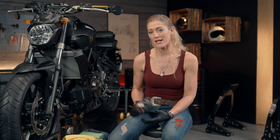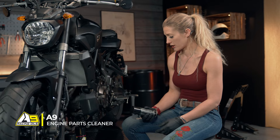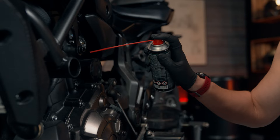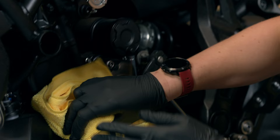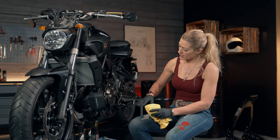That is the A9 brake cleaner. Let's move on to the engine parts cleaner. Again, this is quite a toxic cleaner in terms of your skin, so make sure you're wearing the right protection. A lot of these products will always come with instructions on the bottle, so if you're ever unsure on how to use them, do read up on what it says. This one says: spray on engine parts, let it work for 30 seconds and then wipe off the dirt. Let that sit for 30 seconds. It's always recommended to use these products in a well-ventilated environment. That's cleaning up really nicely — nice and shiny. You're going to want to replicate that process across all of the engine components and you can see straight away how nicely that brings up the shine of the engine.